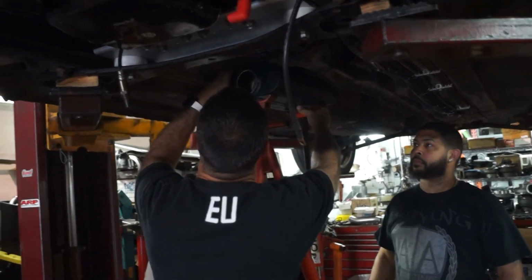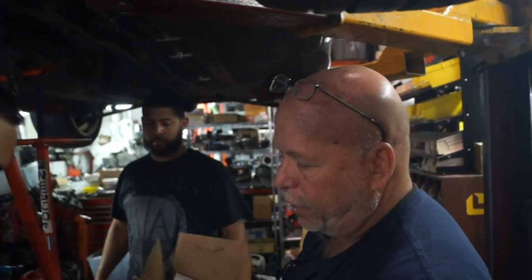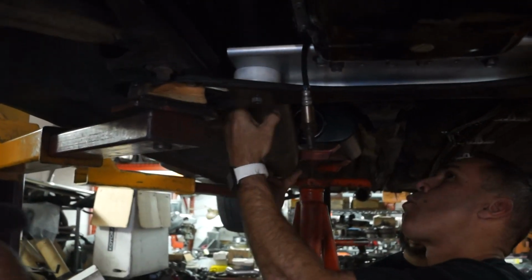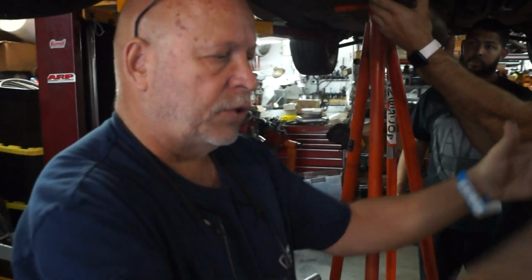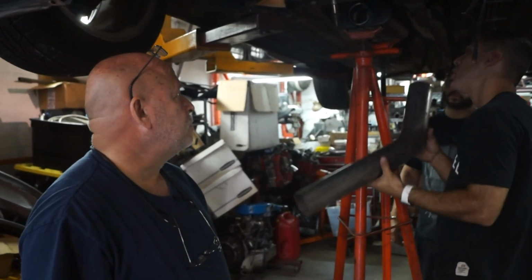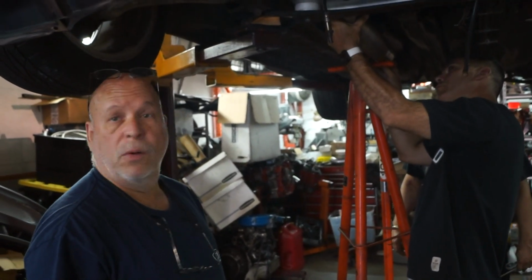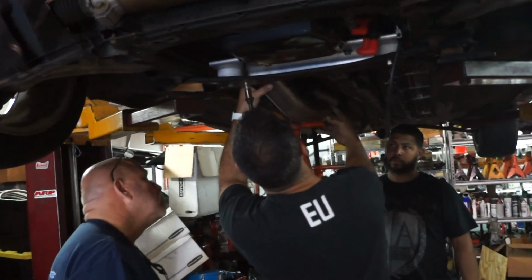No. A Flowmaster is a can that is tuned by the volume and by the chambers inside, and those chambers basically control the flow. If you take a look at it, you'll see they're like 45-degree angles. It's like a splitter. You know how much of that air being exhausted goes around and is contained before it actually exits again. Whoever thought about it, I think got lucky in the technology. Maybe they tried 20 different designs until one worked really well. But it works. It works well enough to get a place on the project car.